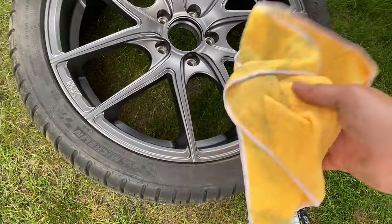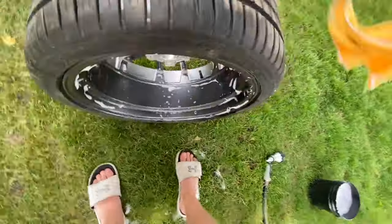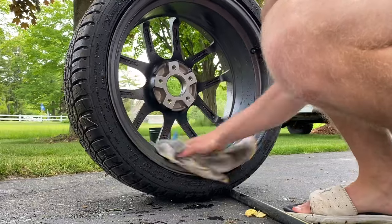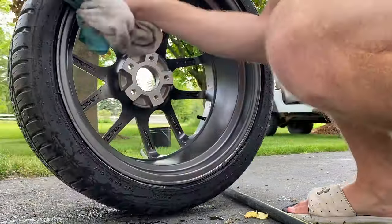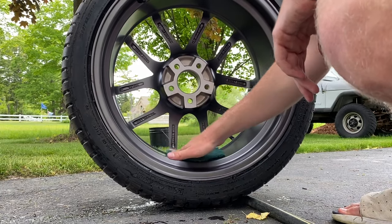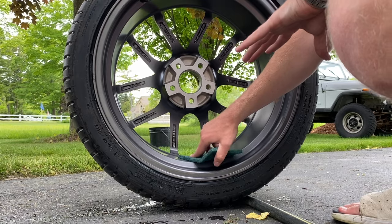The wash doesn't need to be too crazy. This is a brand new wheel, so I'm using an older microfiber towel and dish soap with water. Now that we're clean, we're just going to fully dry the inside, because that's where I'm going to start. Right now I can feel it has a really glossy finish, and we want that to be scratched up so we can adhere the paint when we spray it. Don't cut out your prep work — this is the most important part. This is really what determines how well your paint is going to stick and how long it's going to stay, so invest your time now and you won't regret it.